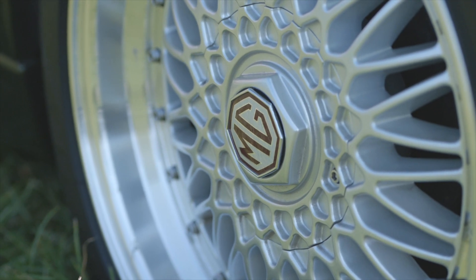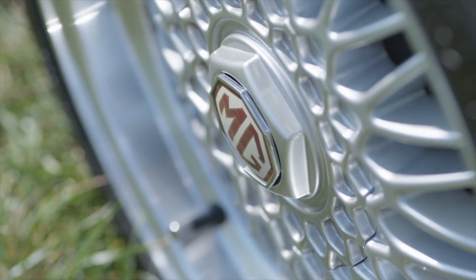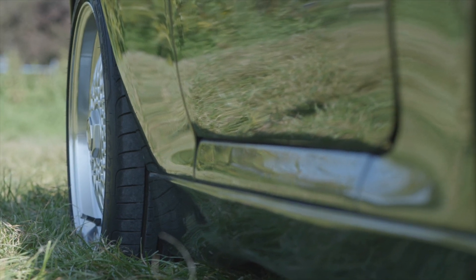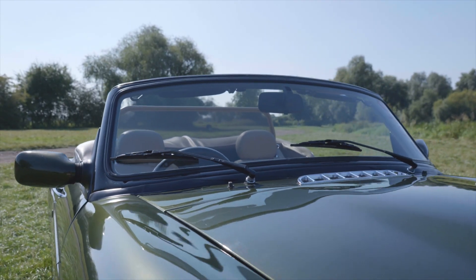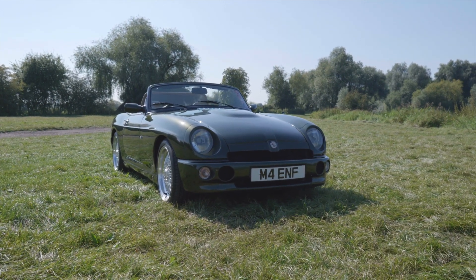The RV8 wheels are a composite wheel — they're no longer available, so you either face a high cost to have them rebuilt or you can buy aftermarket wheels, but they're not the original size. They're a 17-inch replacement which slightly changes the look of the car. If you want it to be original, it's the original 15-inch, so check their condition carefully. Also regarding tyres — we've seen lots of RV8s on original tyres well past their sell-by date. A tyre shouldn't be any older than 10 years; if you've got 20-year-old rubber on the car, budget for replacement tyres.